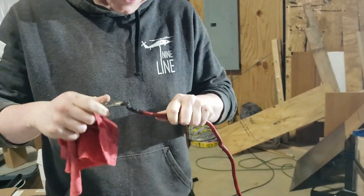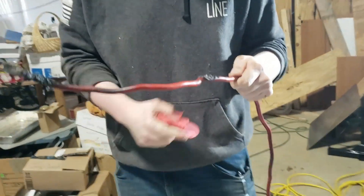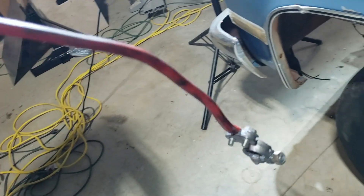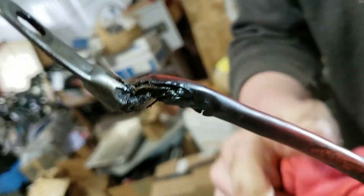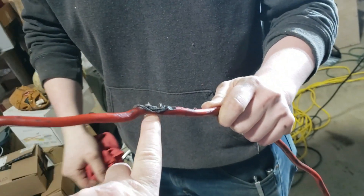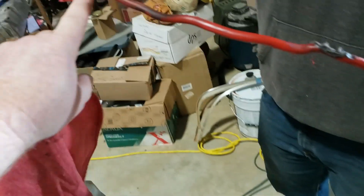Kyle just pulled off the positive battery cable. The main wire on the starter just had duct tape around it — saw a little smoke the other day and wasn't sure why. Turns out the wire was hitting the frame right at the starter; it was touching the frame right there. It was covered with duct tape so it wasn't really contacting anything, but the duct tape was a mystery we had to unravel. We figured we were going to find this, and since it was poorly routed we figured we'd find it again.